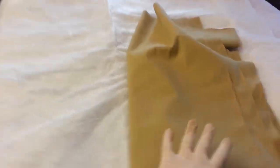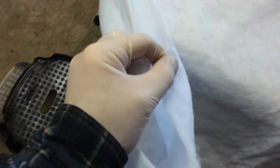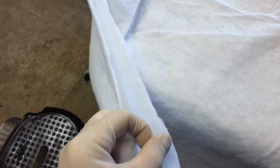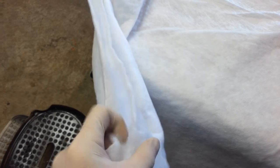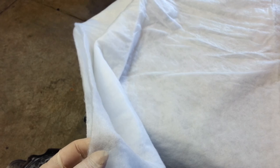The fabric we're going to use is this material we purchased at Walmart. It's a really nice fabric — lighter than what we used on the door panels, but the area is so dark back there around the back window that this will definitely lighten it up. We're also going to use some padding. It's very thin, about an eighth of an inch, but it gives a little more depth to the fabric and an overall softer look than applying fabric directly to the metal.